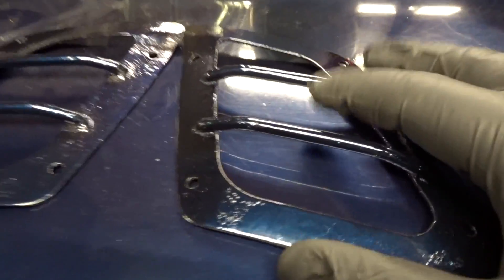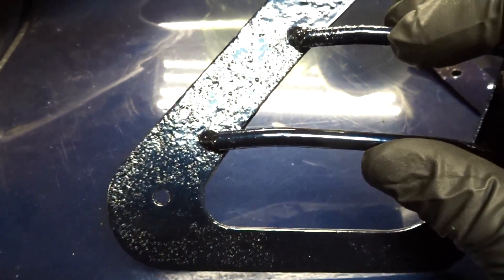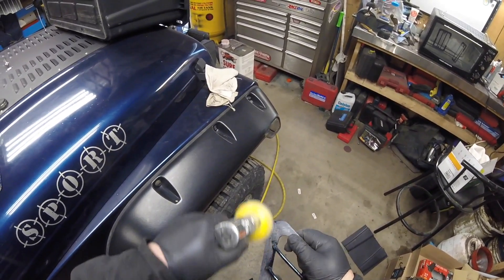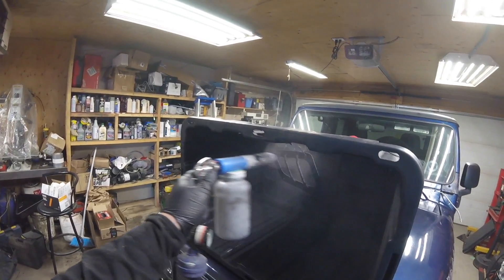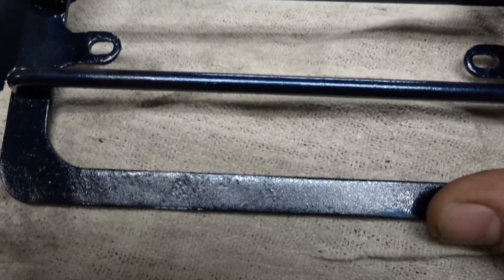We cooked it 15 minutes at 400 degrees and it seemed to coat alright. This is the good and the bad — it actually came out almost the same color as the Jeep. But where the rust was, all the pitting looks like big-time dust in the powder coat, which is kind of a disappointment. I'm thinking about sanding it flat — not removing the powder coat, but just sanding it down and hitting it with powder coat again to see how it turns out. It's interesting why there's more orange peel on the bottom than shine up top — lots to learn about powder coating.